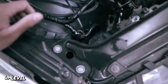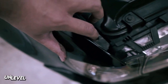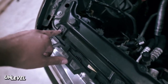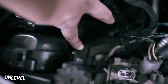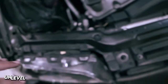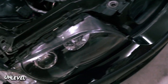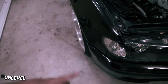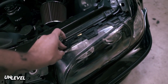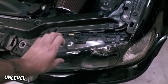The lights have got to come out obviously. The process is: take out the corner light first — there's a Phillips screw in there. Once the corner comes out, there are two eight-millimeter bolts here, one here, and one down in there that you can't see. The lower headlight trim also needs to come out, then the headlight can come out. The headlight lens opens very easily with these clips.